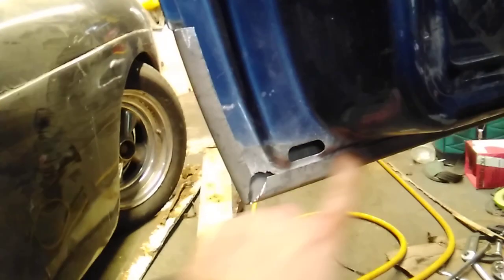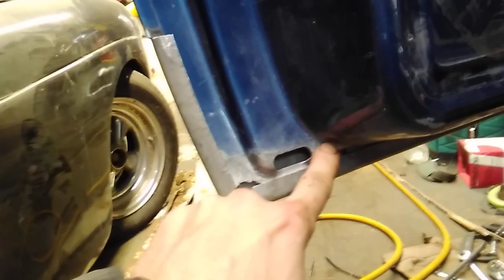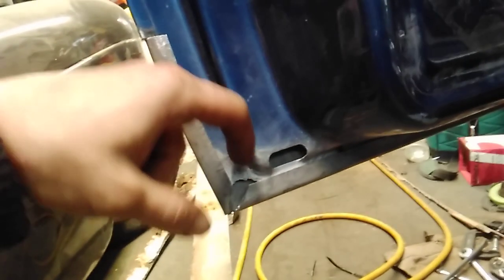The patch piece here has a little flange to it. I left the very corner — this section of the inner door shell — you can see some of it was deteriorated and gone. So I left those corners there and lined up my piece, which was just a piece of sheet tin turned over to a 90-degree angle, so it's on the inside of the door shell, and I put plug welds on it.